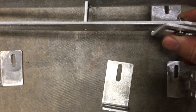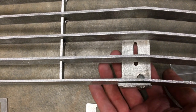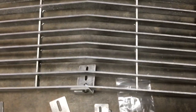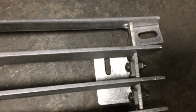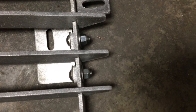You're going to take the M5 button and secure one through this lower bracket. You can see this is slotted so it can go back and forth side to side to line up on your car, as well as a vertical slot to help adjust the height. You can see over here you have that vertical slot on the driver and passenger side brackets as well — it gives you about three quarters of an inch of vertical height adjustment. You're going to slide your M5 through, with a washer on each side, and the M5 all-metal lock nuts go on there to tighten it down.